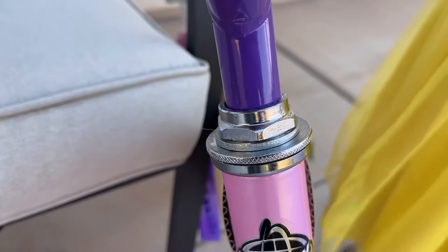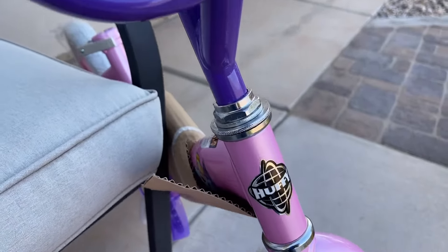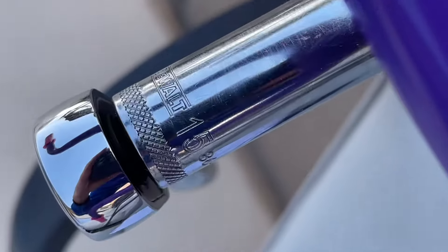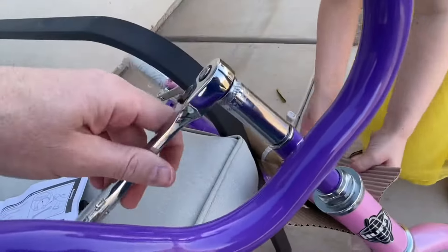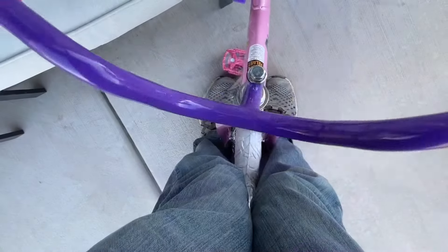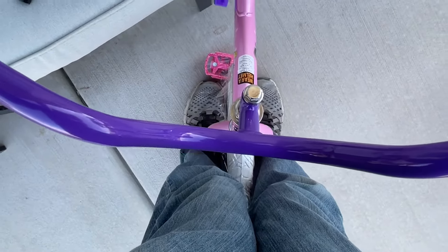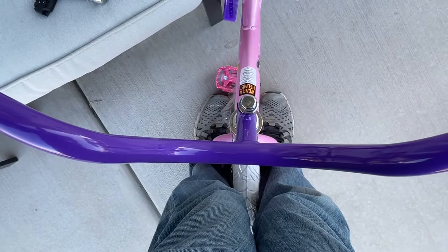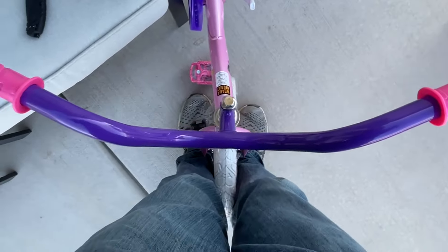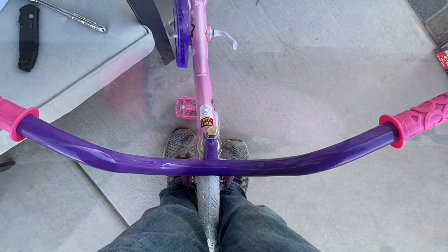Remember those perforated minimum insertion lines — make sure you go down far enough so those lines disappear. Using a 15mm socket from the top, as you tighten this down it moves the wedge out and tightens everything up. Get in front of it with your legs to hold it still, and adjust the handlebars so they're straight. Once tightened down, you should not be able to move the handlebars side to side. If you're holding the wheel, it shouldn't budge — tight, but not too tight.